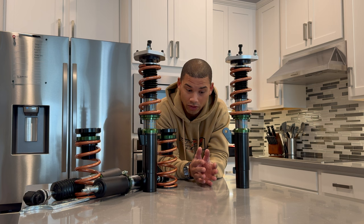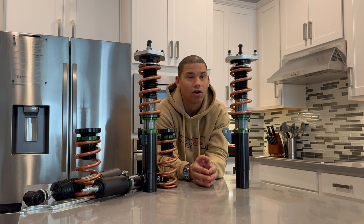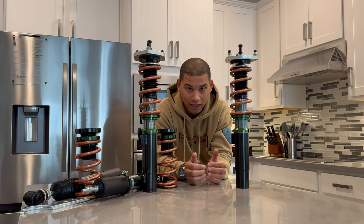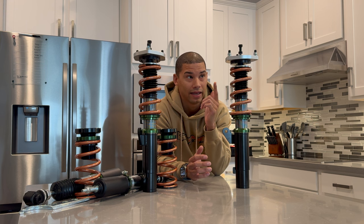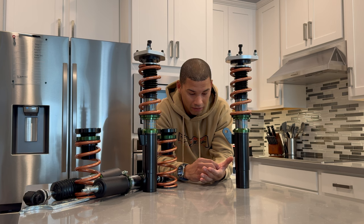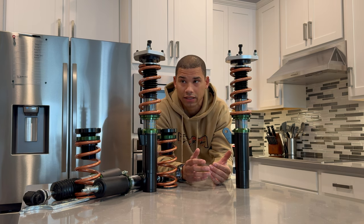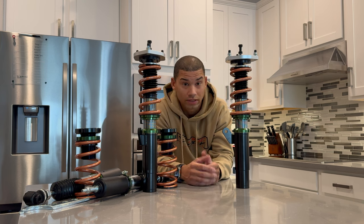So I think we'll go ahead and order a 034 front sway bar to do in the next couple weeks, just to complete everything. The way the car turns in now might be fixed because I think my spring rates are just too low, and the way that the DCC does the struts — it's either too stiff or not stiff enough. So I'll be able to go in and change these on my own, write numbers down, compare those settings to how the car reacts and take notes. Depending on how tight or wet or sticky the course is.